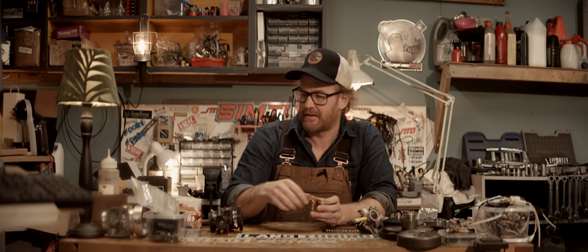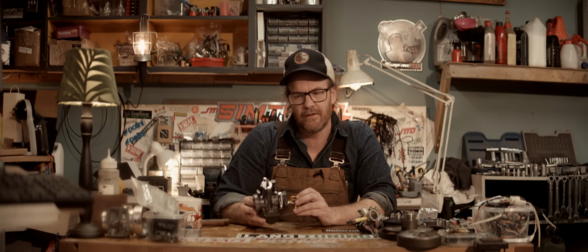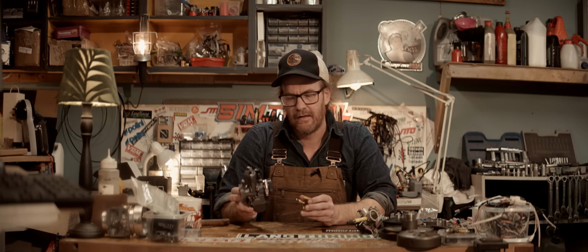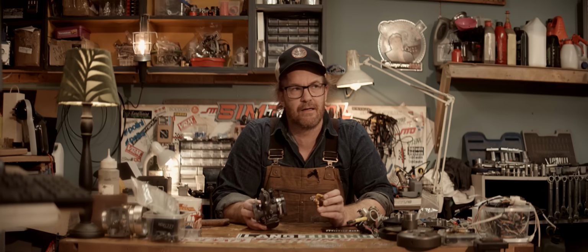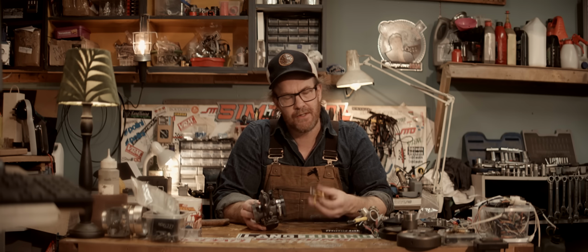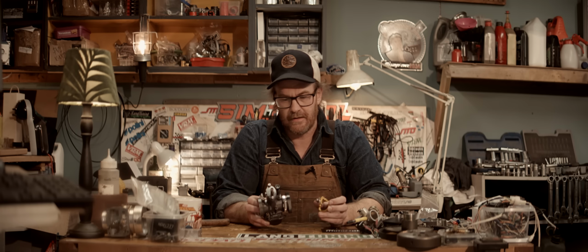Another theory is that if I were to mix the gas with the nitro, then suddenly AFR would be far too lean. And we kind of will be mixing. It just doesn't happen in the carb, it happens in the crankcase. So I'm curious to see if it actually goes richer and richer, or if it actually goes leaner and leaner if I add more nitro.